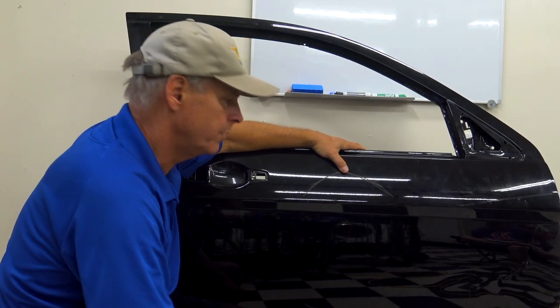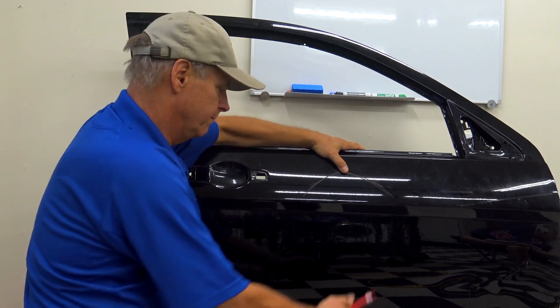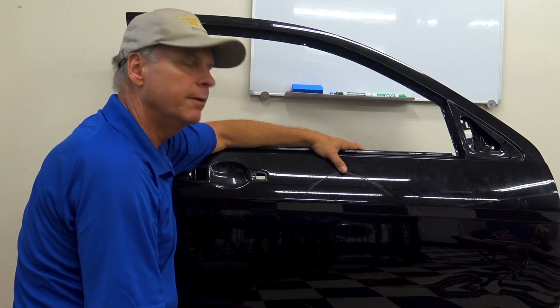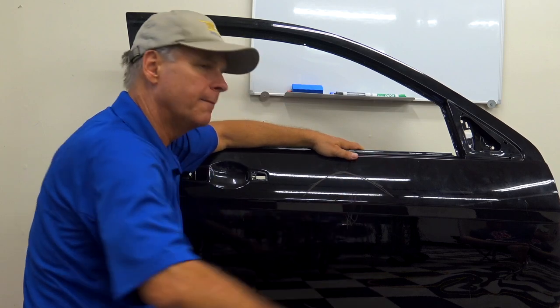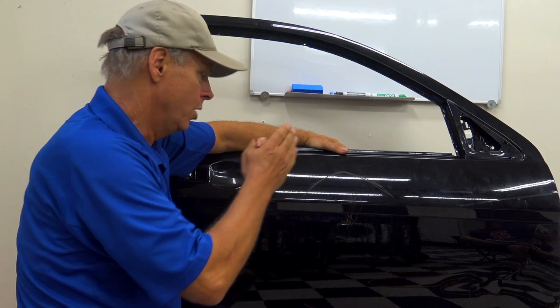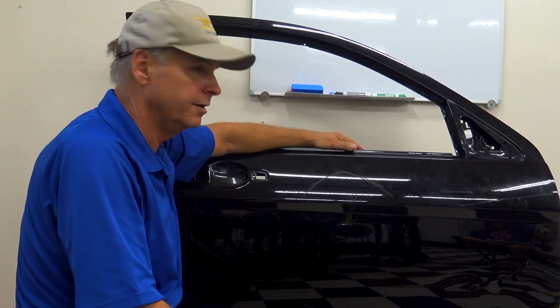Okay, so what happens when we put a body line into the mix? Well, two possibilities: either hit above or below the body line, or hit right on the body line, right? So let's say we have something that hits right across our body line, puts a crown up there, maybe a little one on the bottom. These actually aren't that bad at all. People think, okay, now when they're hitting the body line, you've got to move that body line first. And I'm going to tell you no.